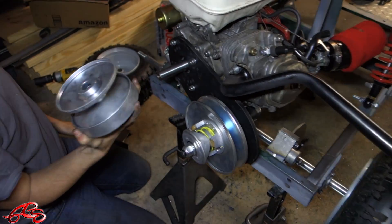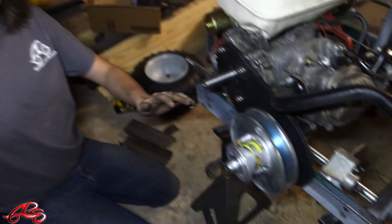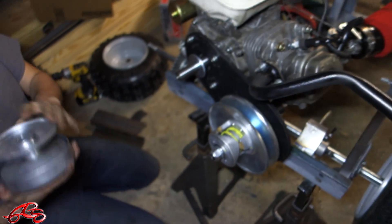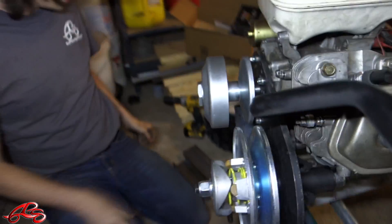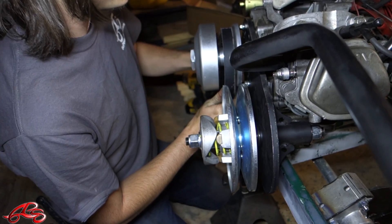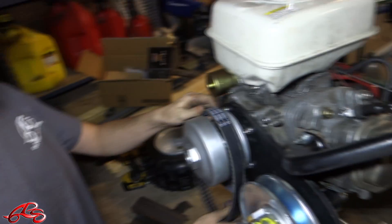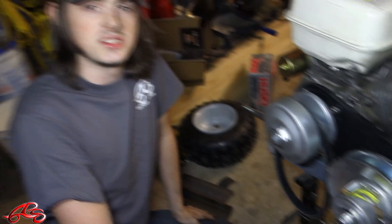You've got to put spacers in the way because you've got to get it lined up — you need your spacers. Before you put your belt on, just find the right measurement. We spent about 20 minutes trying to find this. From my understanding, when this is on during the higher RPMs, your belt's going to slide upwards. You want it in line when it's going really fast. If it's off-center, you're just going to throw your belt. And that's pretty much as easy as it gets.